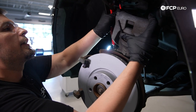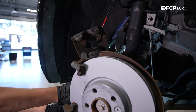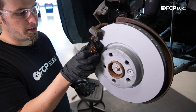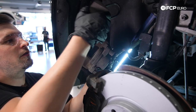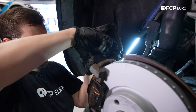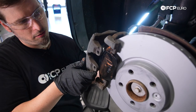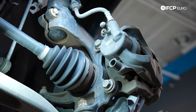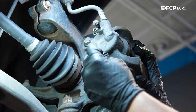We're going to bring the caliper back over so that I can retract the piston into it. I'm going to use a slip joint plier — everyone kind of has their own tool for these, but I find that this works pretty good. The pad without the clip is going to slide into the carrier, and then the pad with the clip is going to go into the caliper itself. Just raise this off and get rid of the hanger, try not to get grease over everything, pop it in, and seat the caliper onto the carrier. For the caliper slide pins, I'm going to use a little bit of brake grease to aid in the back and forth motion of the floating caliper, and put them into place.